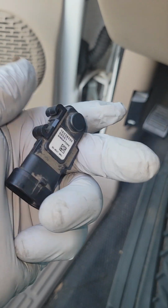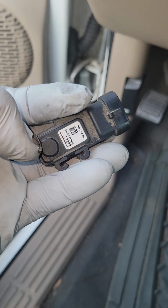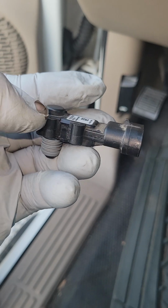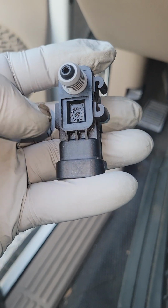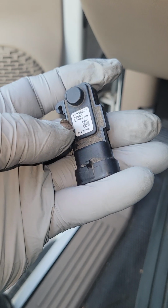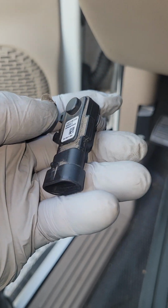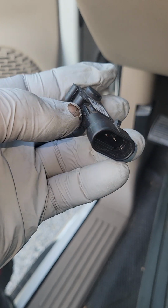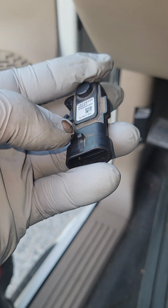So that's it for the most part, guys. Again, just make sure you reset your check engine light. And remember, if you have P0454, it means that you probably have an issue with your fuel tank pressure sensor, which is located on top of your fuel tank or fuel pump assembly, okay? This is really doable if you take your time.